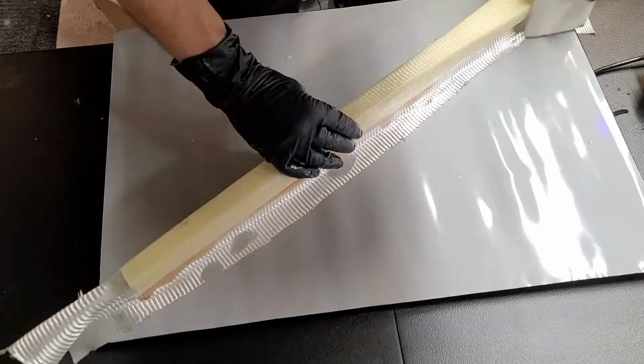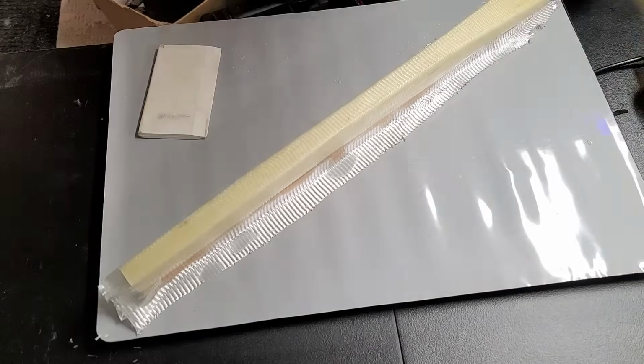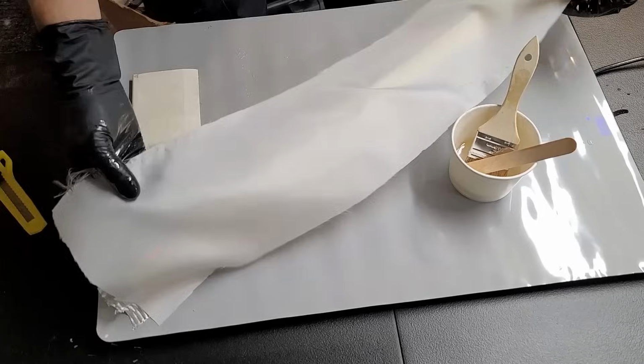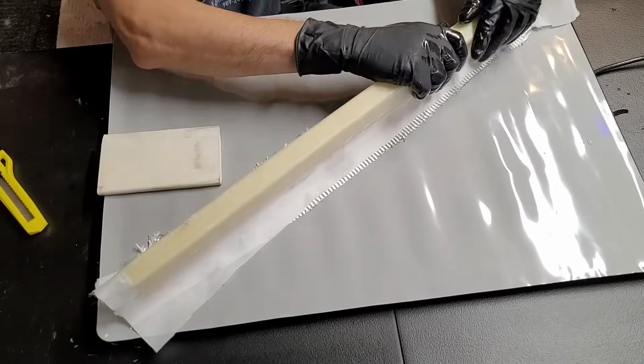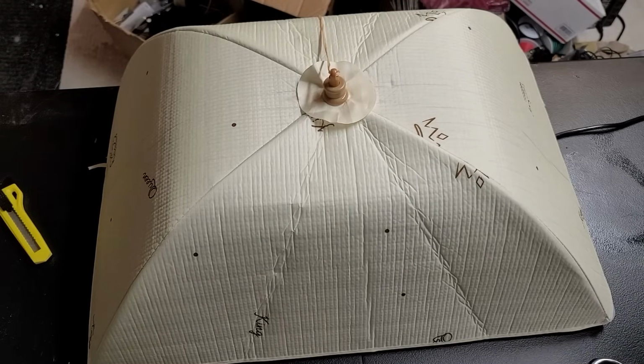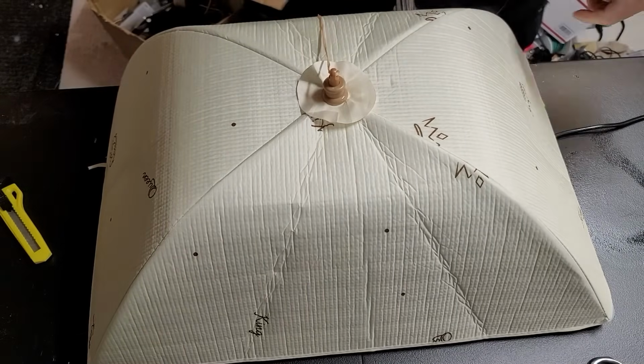And that allows, on the 3 sides that I've just now covered, those 3 sides will be covered with a bid layer of epoxy that is incredibly strong, and I put some Peel Ply on top because we will be bonding more to this. 3 hours later. So I've got this nice heated curing table that does a full cure of the epoxy in just 3 hours, so I can speed this along.